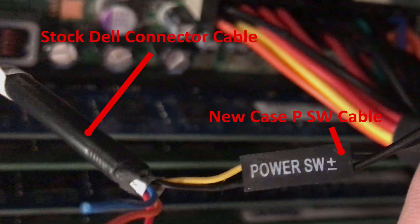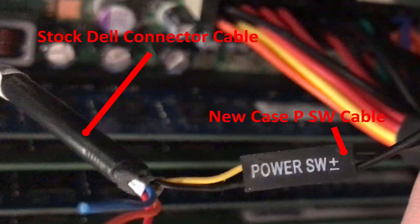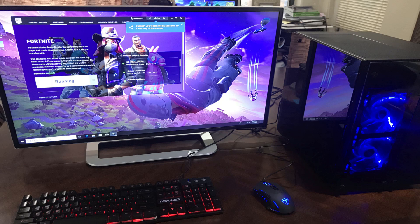In any case, that's how I went about doing that. I was cleaning out my son's computer today and that's the one I'm using in the video so you can see how it all looks stock. The picture I flashed up is from when I was initially putting together my wife's build and testing it. Just cut your yellow and black from your Dell connector cable, cut off your new case connector, and wire those together — you'll have a functioning power button. If you have any questions, put them in the comments. Like and subscribe, appreciate it, hope this was helpful.